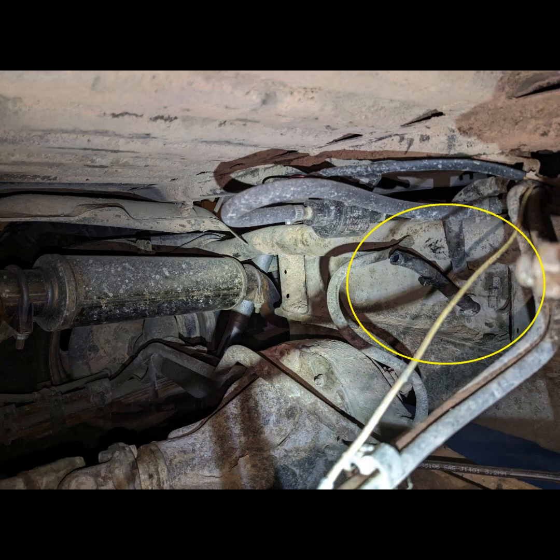While you're back there, check out your fuel lines. Whether you're running the stock fuel pump or the electric fuel pump, that's going to go higher. So disconnect that before you go up, and then you can see if you need to extend that after the body lift is done. Also, another thing to look at is those brake lines up in the front wheel well. Just kind of keep an eye on everything as you're going up. If you hear any creaking or tweaking, stop, give everything a good look before you go up any higher. I also removed all of the bolts before I started lifting the body up. That way, there's no tweaking or anything.